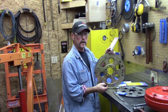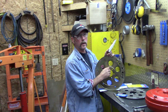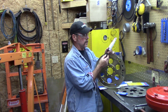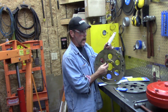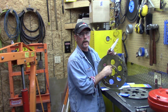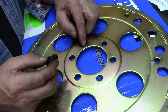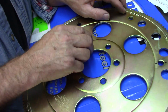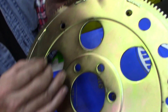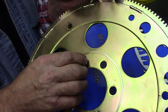So when we put these on, you've got to put the Loctite that they recommend on here, and then there's an assembly lubricant that goes underneath the washer, so as you're torquing it, there's no friction, and you get the real torque into that bolt, not taking into effect the drag of a dry washer head on this steel. So the way these finished holes are, if it was just punched out and really a sharp 90, you might end up having a problem up near the top, but these are fine. As they're stamped, you can tell they're kind of rolled.